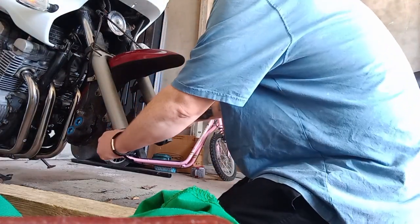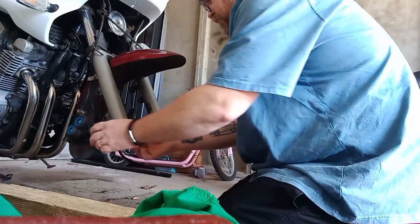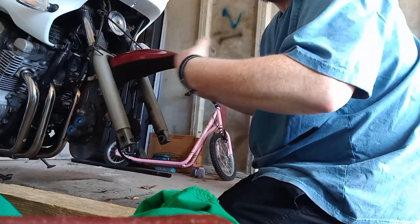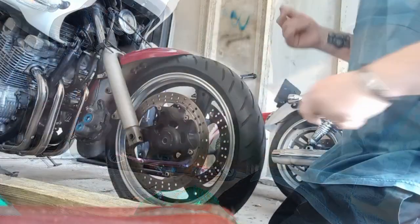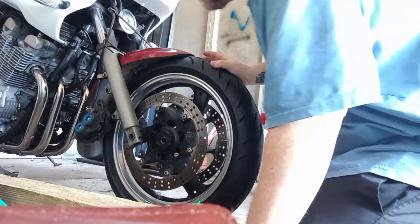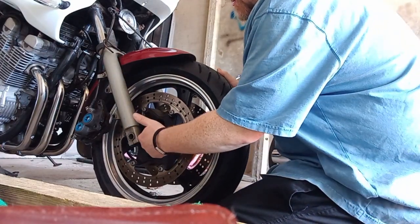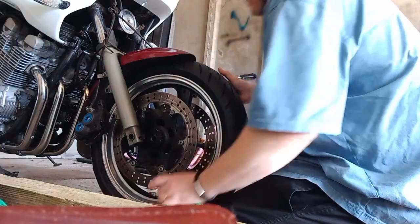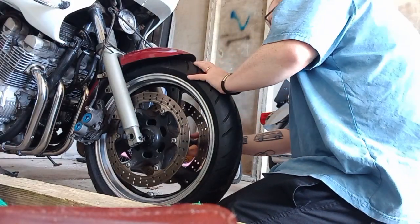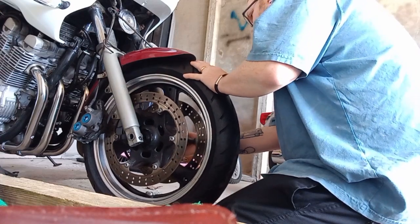The spindle was just put through to keep the jack in position. It's a bit dry here so I'm going to get some grease — actually I don't have any grease in this lockup, so I'll revisit that in a couple of weeks. Now, it's easy enough to decide which way around the wheel goes — you're looking at the side for the washer and identifying the side that the speedo drive goes into. You can easily see where the speedo cable comes down, so that tells you you're putting the wheel on the right way around. Try to get the speedo drive in situ.